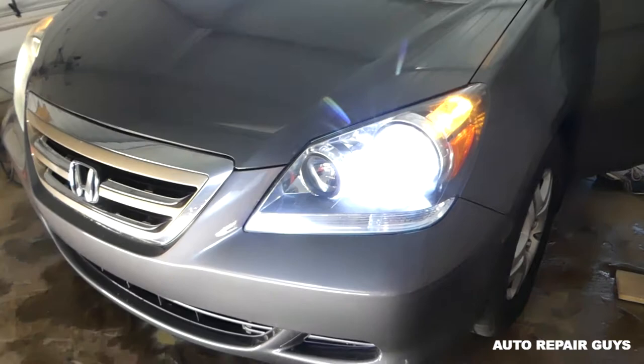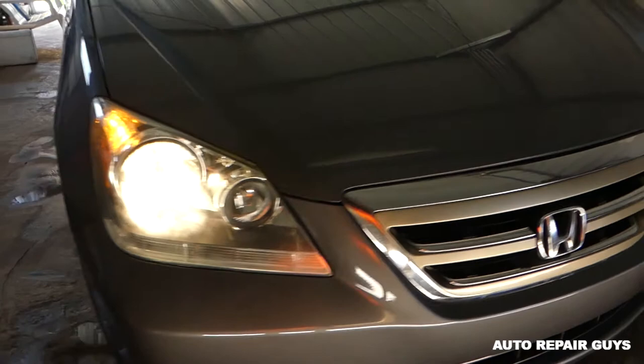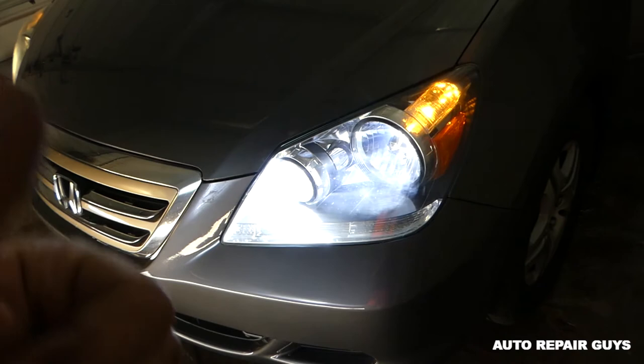Let's turn them on. Low beams work fine, high beams as well. Let's check the pattern on low beams — look at that, it's the same pattern. People might say you'll blind others, but no — a well-designed LED bulb will have the same cutoff pattern. That's high beams now, and it's pretty much the same. Here's a comparison next to a regular bulb — check the difference yourself. Really, really good product. Thanks for watching, please subscribe, and see you guys next time.